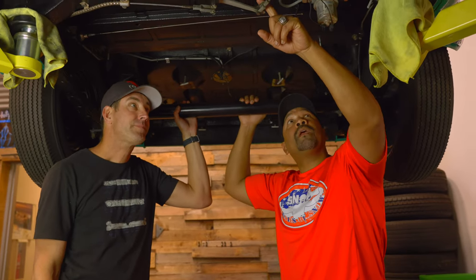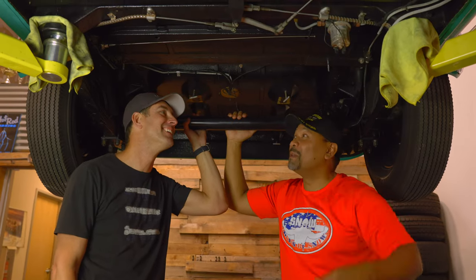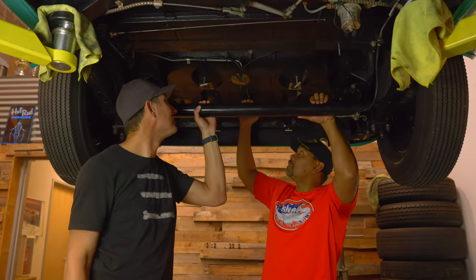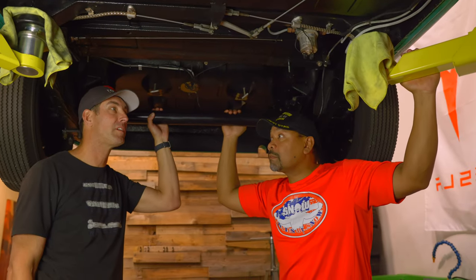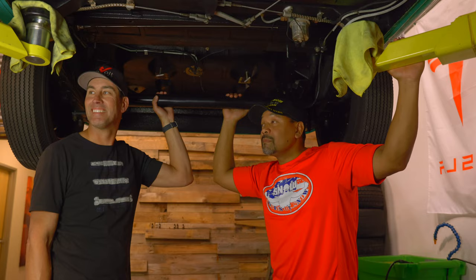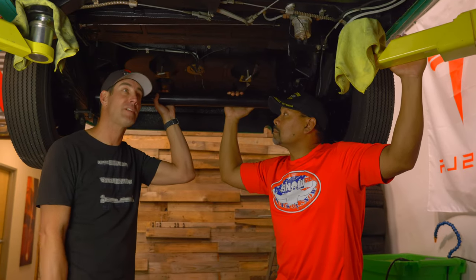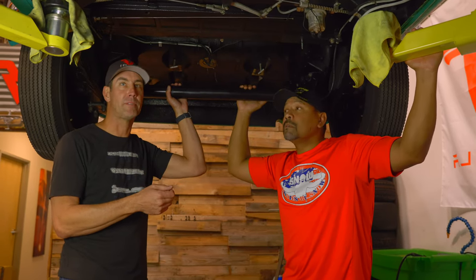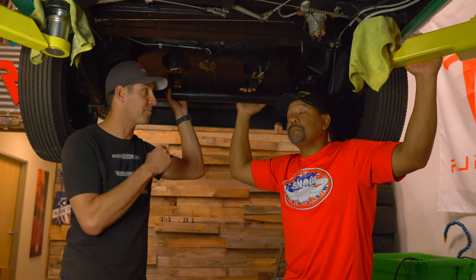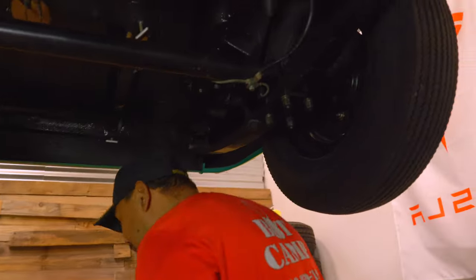We're going to relocate the emergency brake. The fuel pump? That's going in the trash can — that's a paperweight right here. With this pocket and the flatness of the car, putting the batteries under here looks pretty straightforward, but we're always going to run into gotchas. We do have to upgrade the suspension — we're adding weight to the rear that was never there before. The gas tank was roughly 100 pounds; we're adding a 350-pound pack back there. So we'll beef up the leaf springs and put some real shocks on it. These shock absorbers are from 1936 — they're like a lever pump, pretty cool, but the damping just isn't going to be enough.